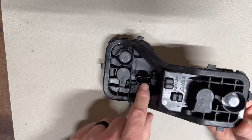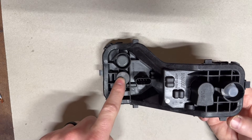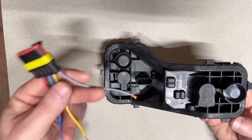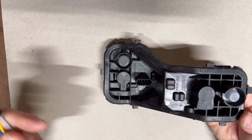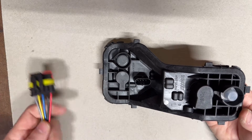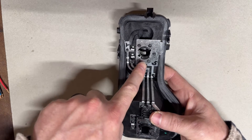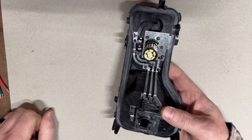These European taillights have a 4-pin plug, but the factory connector is a 5-pin plug — that's because the reverse lights are not integrated into these taillights, which is what all this work is for. You could just get a 4-pin to 5-pin connector wired up correctly, tape off the reverse light wire, put in your resistors, and you'd be done — but you'd have to live without reverse lights or rig up auxiliary ones under the bumper. Up here is your factory brake and taillight socket; it's already set up for one of these, so you just pop it in — that's the easy part.